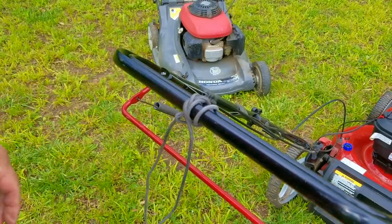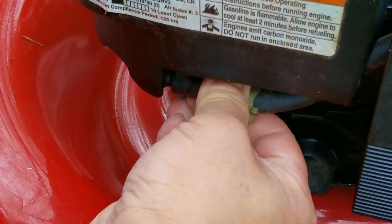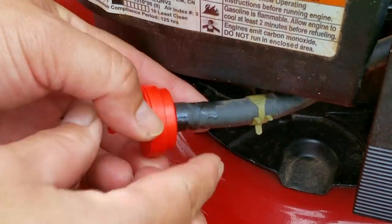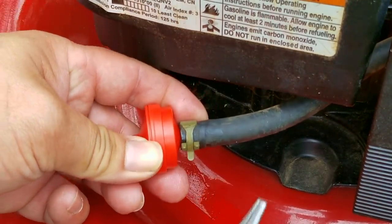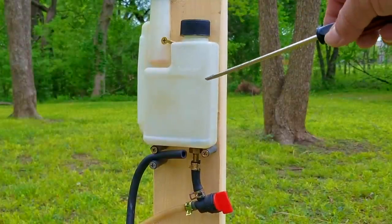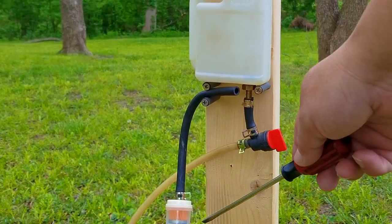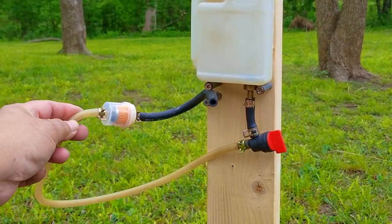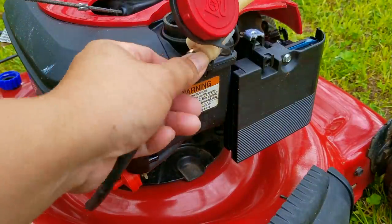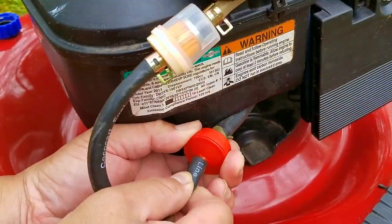The fuel lines will be disconnected at either the fuel tank or an acceptable point, because all the mowers vary slightly in their fuel line routing. Depending upon how the fuel line is removed, there might be a red mesh filter used as a splice. However, there is already a clear paper filter installed in the line from the test tank. The test tank already has marks on it — I'll be filling it up to the 8-ounce line. The fuel will leave through this fitting and through a shutoff valve, and then through a couple of feet of fuel line. There's already a clear paper filter in line to keep debris out of the carb. Since this is a gravity feed system, I need to keep the line from sagging below the carb, so I'm going to try to route the line so it's always pointing down, but this doesn't always work.